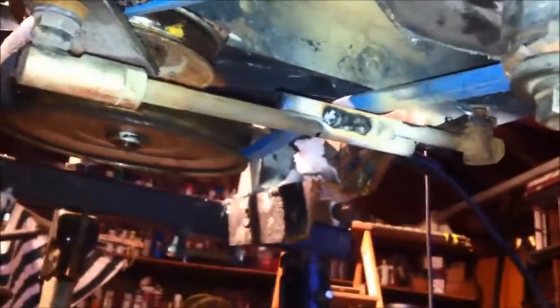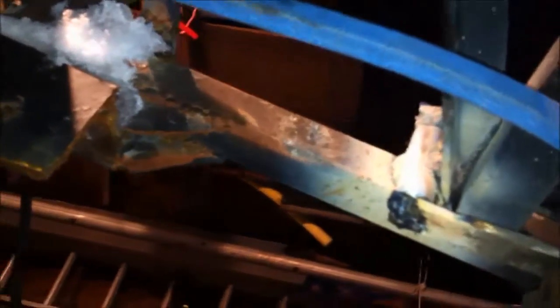Underneath here, I got everything in, and I got my rod cut and re-welded to the appropriate length. There's that pivot point. I have a little bar coming off of it — it's actually a sleeve for the pivot point right there. A little bit hard to focus with the flash on, but I have that adjustable rod, a little cotter pin, and it comes out over here. As you can see, that rod right there — it's just a sleeve, as I said, with a bolt. It's not removable, but welding top and bottom makes it a lot easier. I drilled a hole on this side and that side, it just slipped onto the bolt that goes through the sleeve, welded around that, and welded the head here.